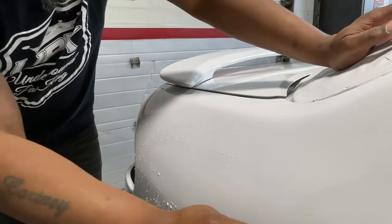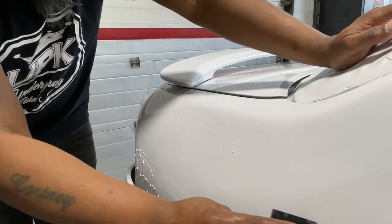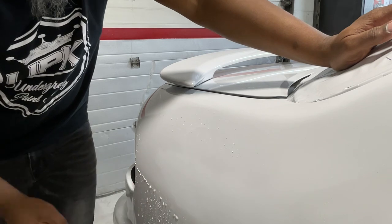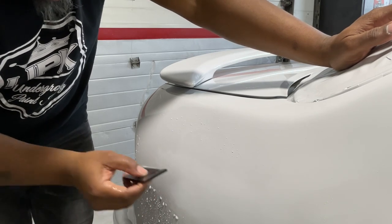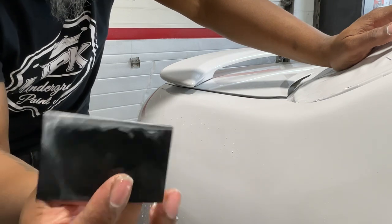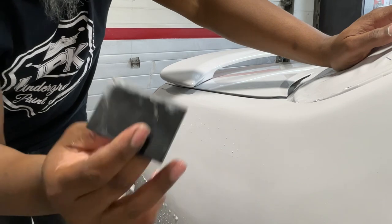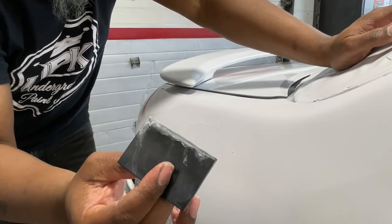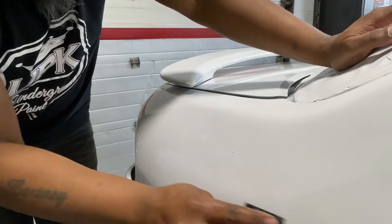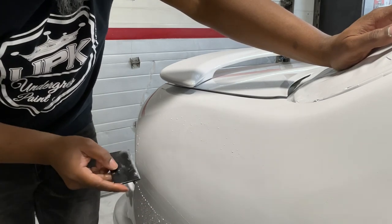Alright, so I got my squeegee here. Just going to squeegee off some of this and see how we're looking. I can still see it a tad bit here, but you can see that we knocked those heads down and got it where we want. And as you can see on the squeegee, you see color — that means single stage. If this was just straight up clear, it would be clear, and then base up under the clear. But because you can see the color, that means it's a single stage paint we're wiping off. So now I'm going to switch my block and begin blocking this out and flattening it.